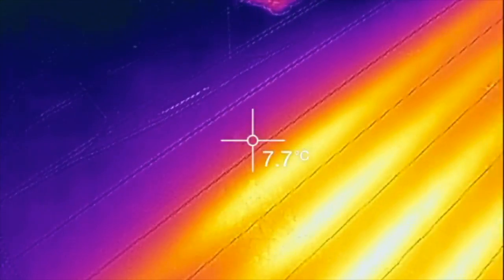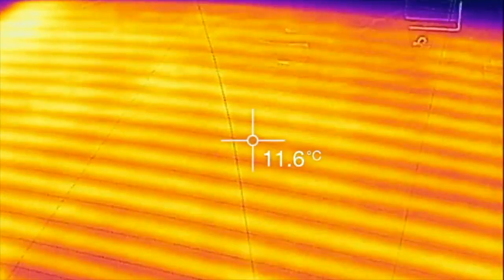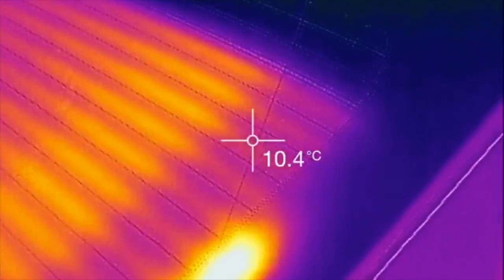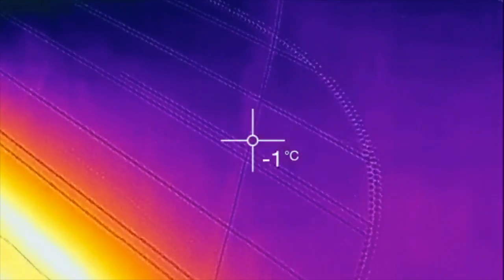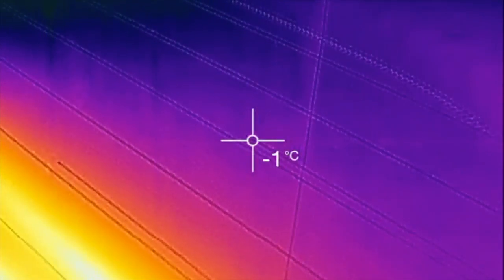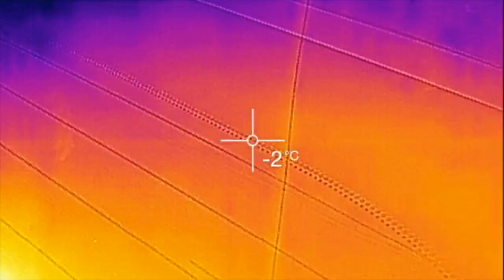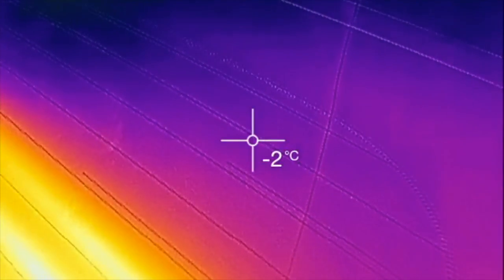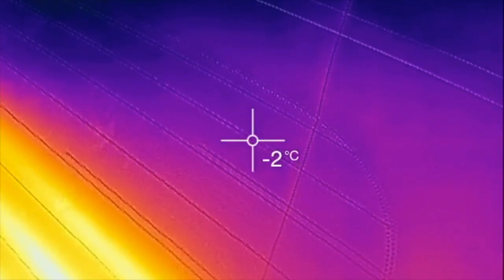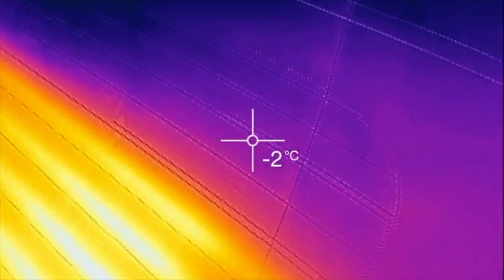I have a suspected reason for that - I think it's a very good reason indeed. Let's look at the other side of these two elements that are not heating up. You can see there's a double element there, and there's a double element there. Quite simply, I don't think they're heating elements - they're the radio antenna, and that little double bit is like a matching section.